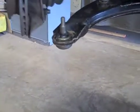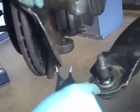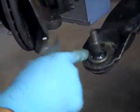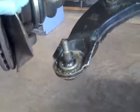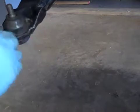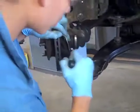Now insert the snap ring back on. Make sure the groove goes all the way around — if you need, you can even use a screwdriver and kind of push it down and make sure that it's in all the way around. Once you've done that, put your boot back on and really push it. You can also use your screwdriver and push it down all the way around.